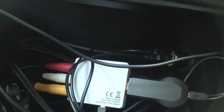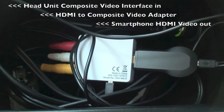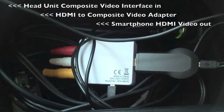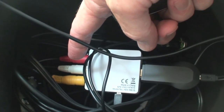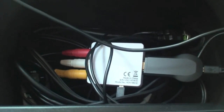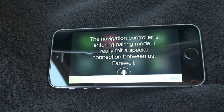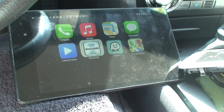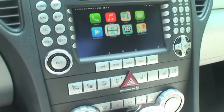The casting device — this is an inexpensive one, or you can use an authentic Google Chromecast — is going to mirror the Android screen and send it into the same input that we'd otherwise use with iOS, coming out of the lightning-to-video adapter. This is the video adapter box that goes off to the head unit's video interface, and this is the casting device that takes the signal over the air from the Nexus tablet. The navigation controller is entering pairing mode. So here we have an Android tablet — this is a Nexus 7, sweet product — running the latest version of Marshmallow, and we're mirroring it on the screen.